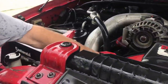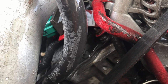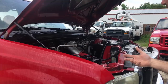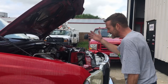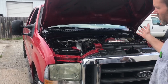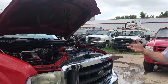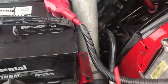You can spray right down this passage and try to clean off the ridge from the valve cover gasket to the rocker box to the valve cover. All I really want to do is get the water spots off, because a car wash isn't always the best for this — a car wash wand will actually damage a harness and damage other things. I'll also go underneath and spray the radiator connections. We're not gonna clean the bottom of the truck while it's on the concrete. This is a top-end injector job, so I want to get what we're gonna work on clean.